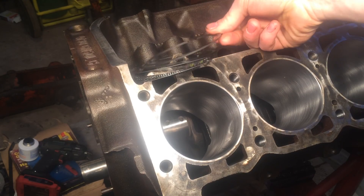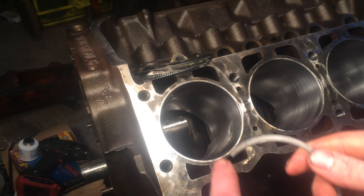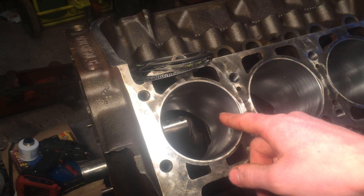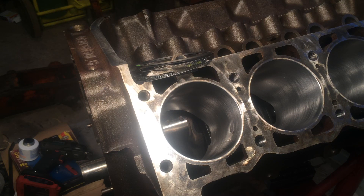If you find that your clearance is too tight, what you have to do is just file the ends down ever so slightly. Remember to take the burr off after you file them so it doesn't scratch things up, and keep going until you get your clearance. I've actually never had to do that — every set of rings I've bought has been right in range. In the next video I'll show you how to install the rings on the pistons, but before that I'll also show you how to check your piston-to-bore clearance. Thanks for watching.